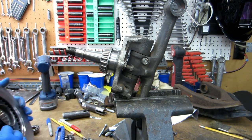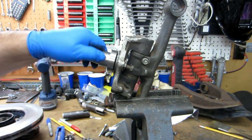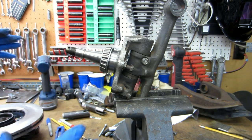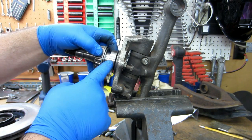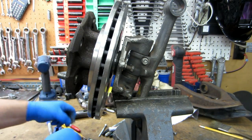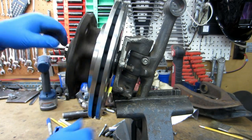Throw three bolts in. When you go to the scrapyard and pull the hubs, make sure you save these bolts and take them with the hub — if you don't, you're kind of screwing yourself. They don't have to be torqued down. Now we can put it up on the spindle. We don't have to worry about the seal or anything because it's all just test fitting. On here is a test version of my inner bearing adapter. This is a hard body inner bearing — or 720, 620 drum. They all use the same bearings. Everything's dry; don't need lube.